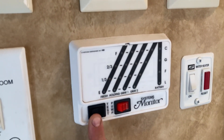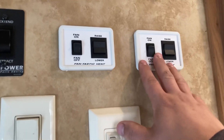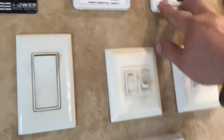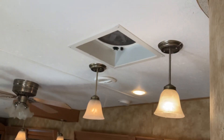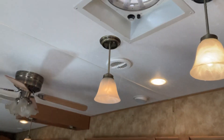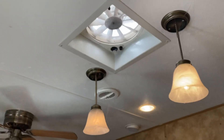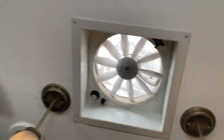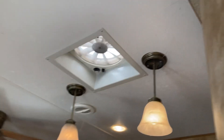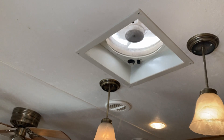You got a water pump switch — that's for when you're using the fresh water tank. The switches up here control electric fans. The first one is for the fan above the kitchen: raising it raises the lid. There's a Max Air cover on top, so once it stops going up, let off the switch — don't keep holding it or you'll eventually break it. Then there's an on/off switch to turn the fan on, and when you're done you can lower it.